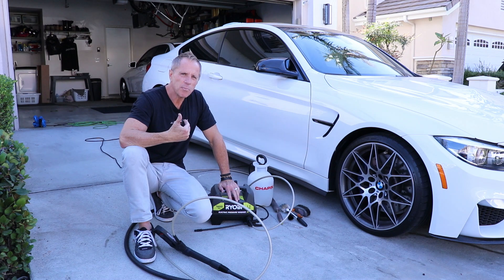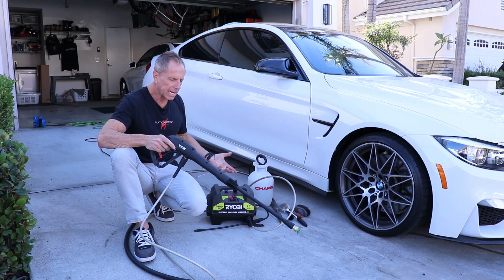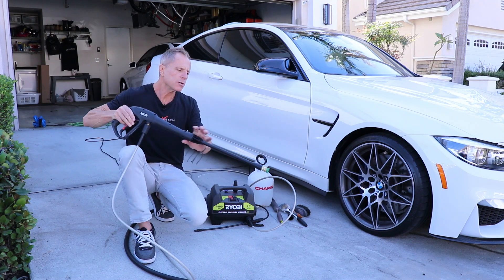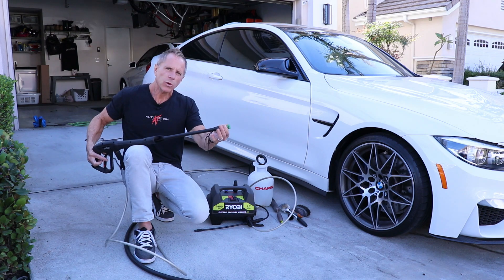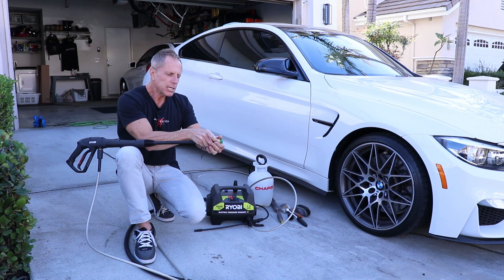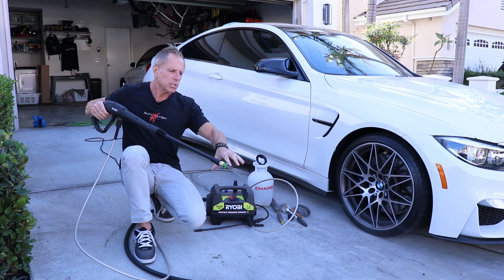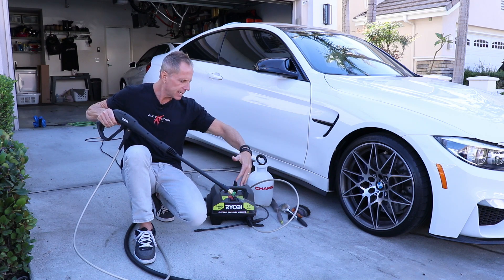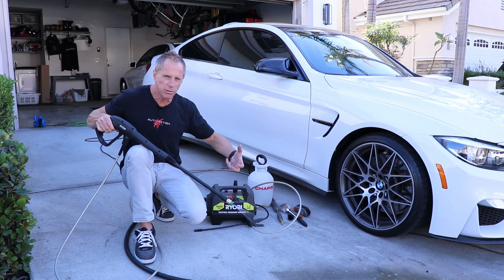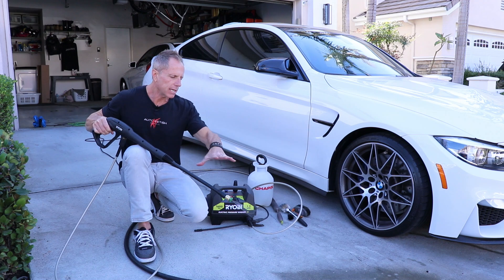Based on your circumstances, you may need to manage that water so it doesn't dry on the surface. You're not going to want to wrestle with your hoses and cord any more than necessary. Now that you've got everything hooked up, including the power — it's plugged in but the machine is not on yet. What you want to do is check that your nozzle is in completely. This is a quick release, which means you may put it in thinking it's fully engaged when it's not. I'm using the 15-degree wand and I want to prime it — get all the air out of the line. See that? That's some air in the line. If I turn this machine on and it pressurizes and hits a big area of air, it's going to do things you don't want it to do. So I want to fully bleed this and make sure all the air is out.